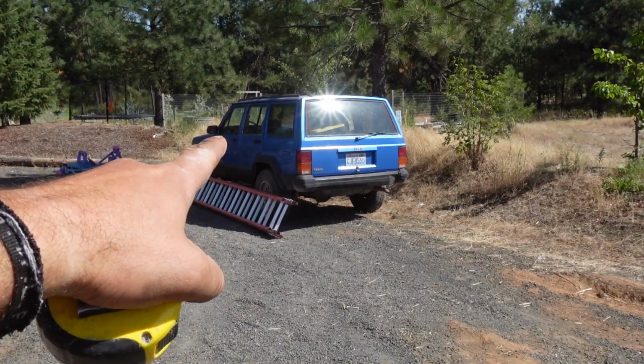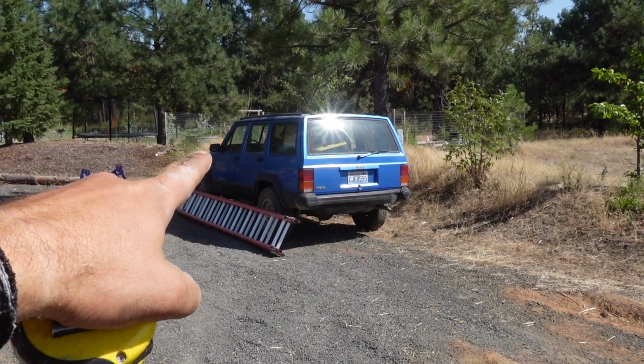This guy has been giving me problems the whole time. So basically what I've done so far, I've done the fuel pump, didn't fix it. Fuel filter, and I changed the spark plugs. I just about didn't make it home from work with it because it's just surging and then popping, and it's got a check engine light for lean condition.